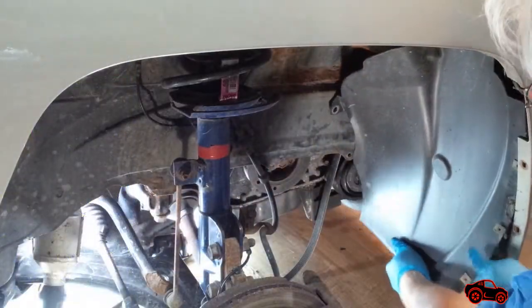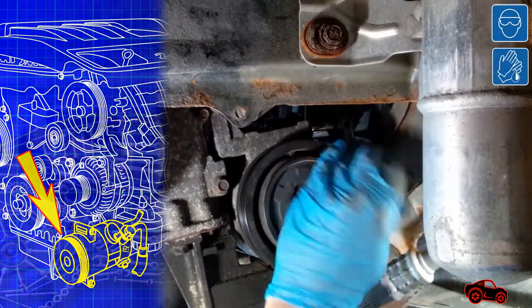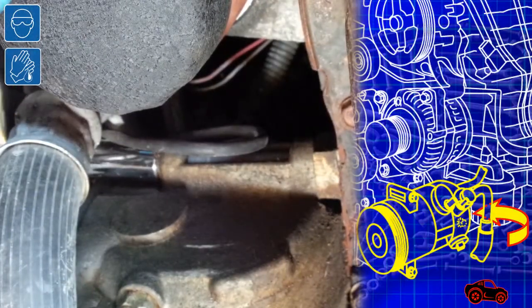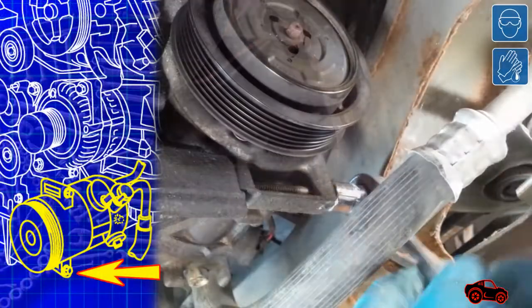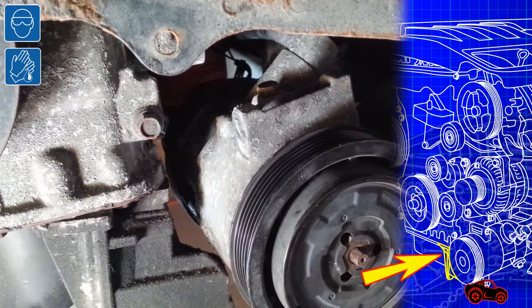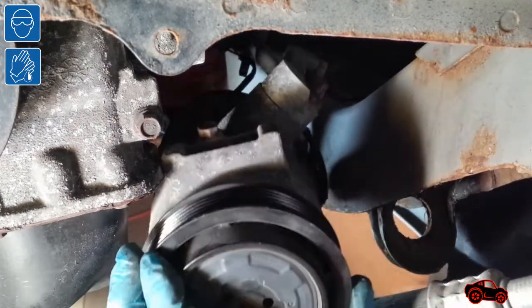To gain more working space, I moved away a section of the fender liner and held it with a bungee cord. Then it was time to lower the AC compressor. Three bolts are used to hold the compressor in place. I began with the easy one to see if they were difficult to unfasten. The second bolt required more time and two different tools due to limited space. I simply cut the cable tie holding the harness loop — the wires were long enough to lower the compressor without unplugging the connector. The third bolt was removed without problem. However, the lower bracket was preventing the compressor from getting lower, so it had to be removed. Even without the bracket, the AC compressor was firmly attached with the AC lines and the space to get the alternator out was still very tight.